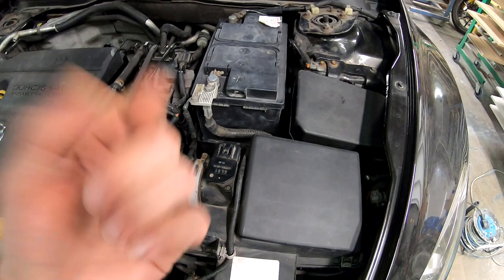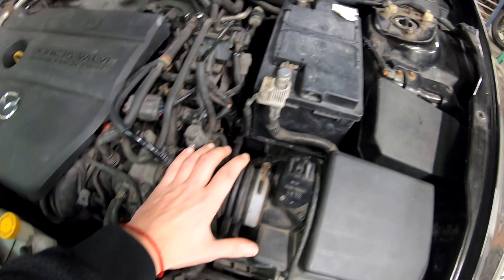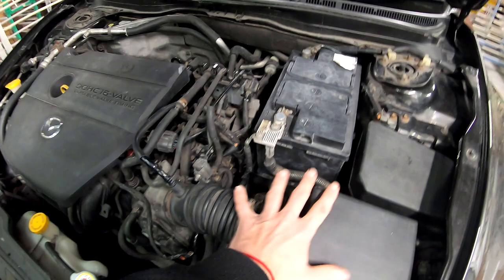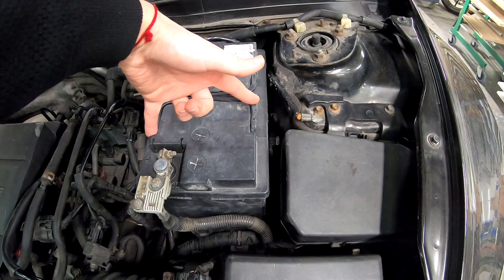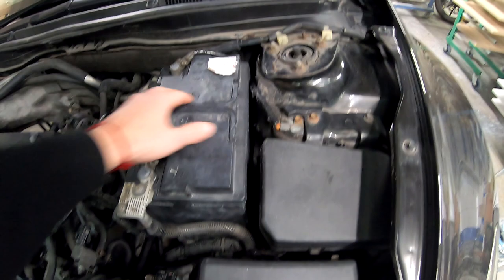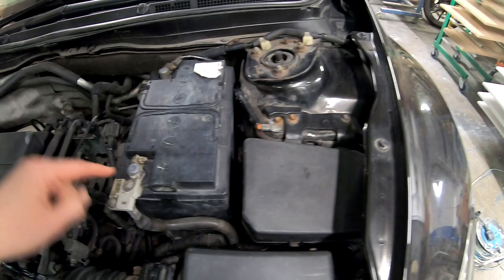So the air filter is coming off, the boot is coming off, the battery tray is coming off, and then this hose, which sneaks around there and here. But once I remove all of this, you will see. Here should be a support bracket for me, but as this is a stand-in battery, my own one is charging and this one is a little too big to put the clamp down. So until it charges, I don't have any tie down. So loosen the tie downs, take off the terminals, basically. That's what will be happening in the engine bay.